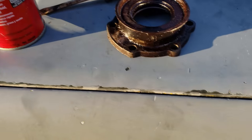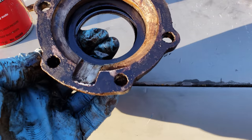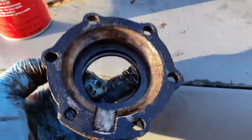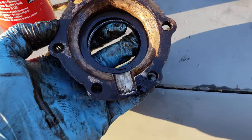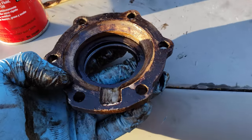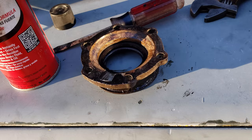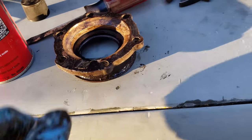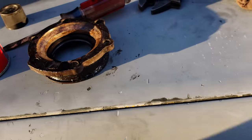I was just going to transfer stuff, knock out that old seal, and put her back together. I could have taken that seal out in situ, but got it out. There was a real thin gasket all the way around there, but I'm just going to smear the crap out of it with Hylomar Blue and call it good. If it leaks too much, I'll go back and order an actual gasket, but I don't have one and my gasket paper is all too thick for that.